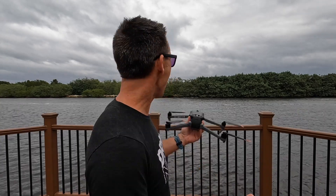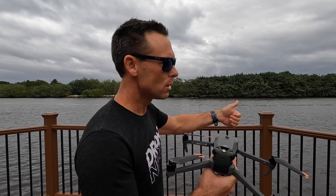The next thing to do after finding the proper location on the boat and calculating the wind and current is to tell the captain to maneuver the boat so the wind is at my back. I would go up to the bow of the boat — for demonstration purposes I'm on a dock right now — and have the drone facing outward, whether it's in my hand or on a good launching platform, and get ready for takeoff. I want the wind at my back in case something bad happens; I don't want the drone drifting back into me or the boat. It's also easier if something happened quickly and the drone was coming back at me to go forward on the sticks instead of backwards.